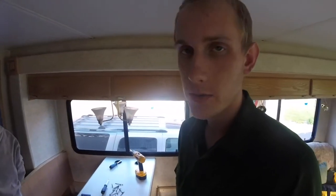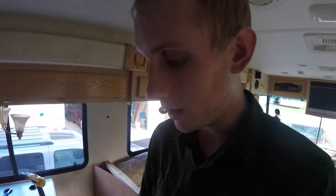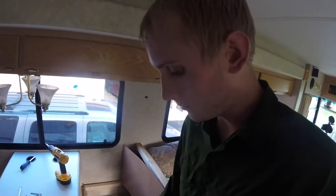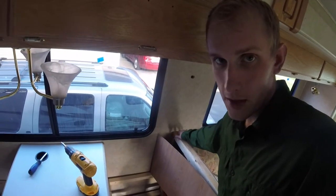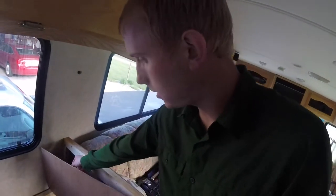Renovating an RV is full of all sorts of challenges. We are trying to take the dinette out so it'll be easier to rip up the carpet and lay the flooring without having to cut pieces to fit around it. We thought it would be pretty easy — just unscrew about six screws in the floor. But it turns out it's also anchored in the wall. When they built these dinettes, they framed them out first, screwed everything in including into the wall, and then put the paneling on. So the screw to get it off the wall is behind the paneling.